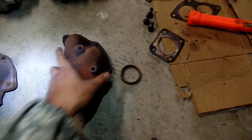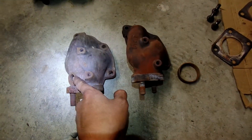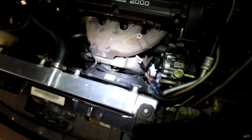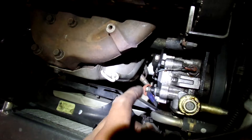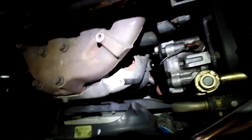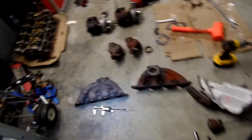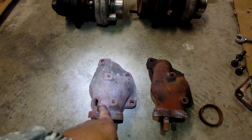Now we have the O2 housings. Immediately I can tell the difference is where the oxygen sensors mount — that's different. How fortunate that I have a 2nd gen Eclipse with me right now. You can see the O2 sensor is down there on the car, whereas on the 2nd gen housing there's a cutout for it. So you could just swap them and still use the heat shields. The O2 sensor on the 2nd gen housing is located in a different place — lower.